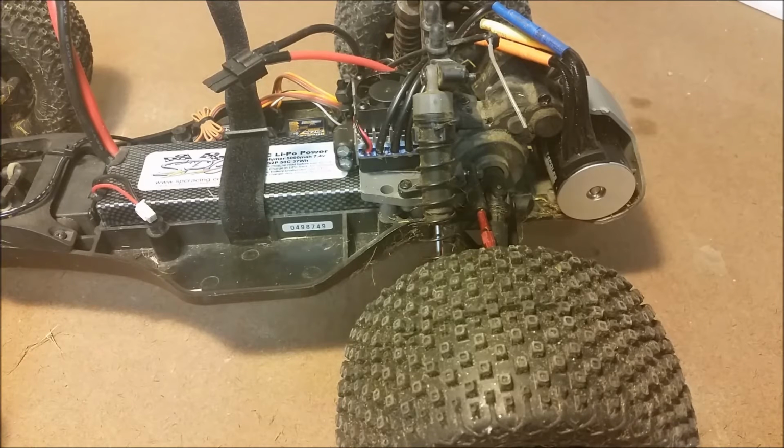is that on the bottom end, it has no cogging. You can't go super slow with it. Once you get to the on point of the throttle, it kind of wants to get going. And that might be because of the way I have it geared to compensate for the lower KV. But no cogging, which is great. I'm really happy with that.